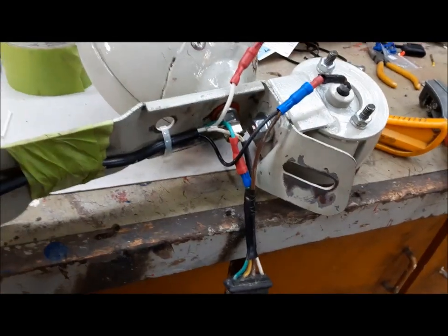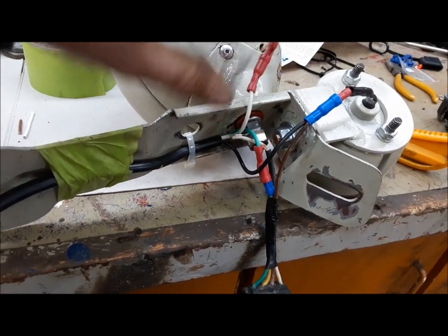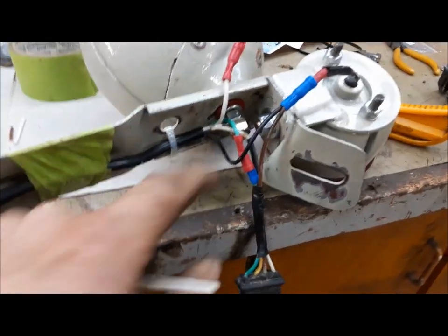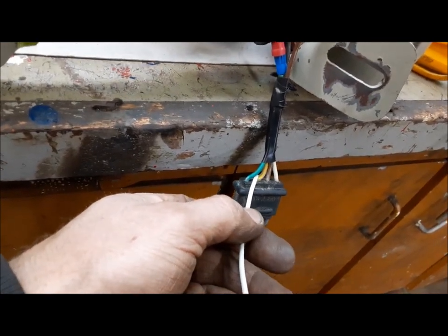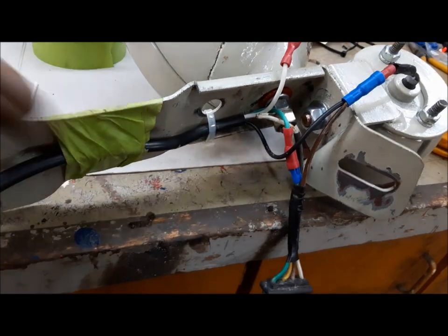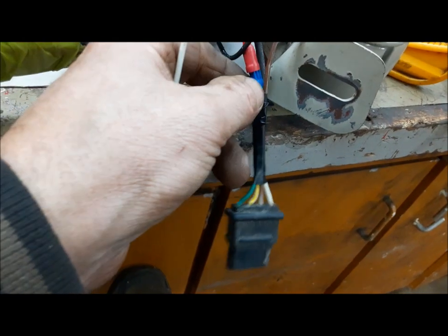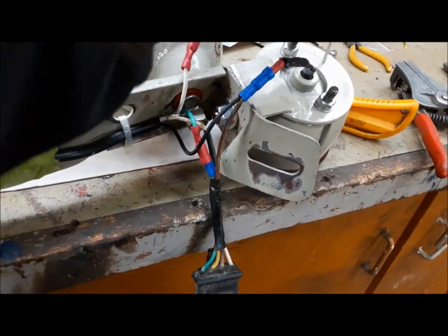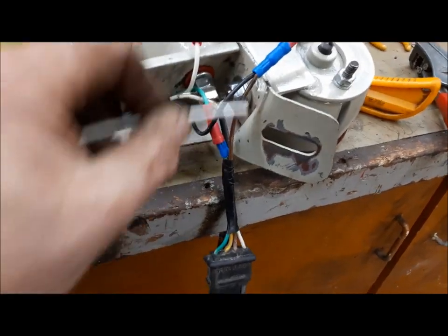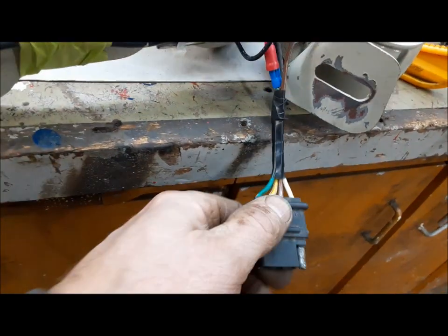So it's not entirely easy to see here — there's a lot going on. We've got the white wire coming from the front, white to white. Then we've got the green wire coming, and from our trailer plug we've got the yellow and green — those are the turn signals connected to that green. There is no left and right on a tractor; if you hook up a trailer, you want both tail lights to flash, so that's how we accomplish that. The black wire in our 16-3 goes up to the brown wire in the tail light, which is the parking light part, and the brown wire to the trailer plug — also the parking light — is spliced into that.